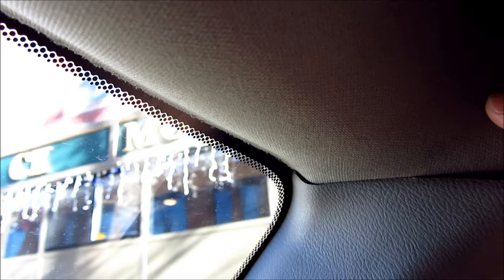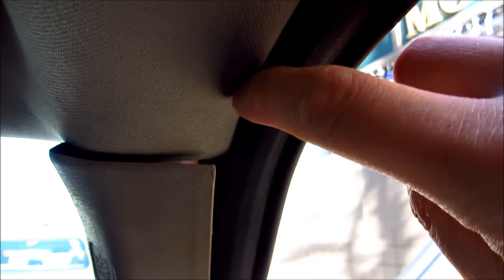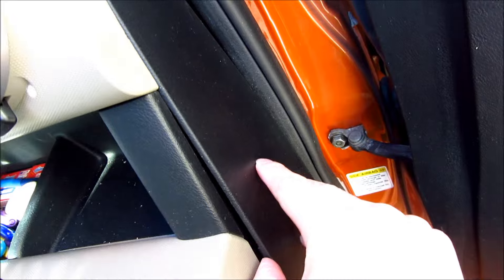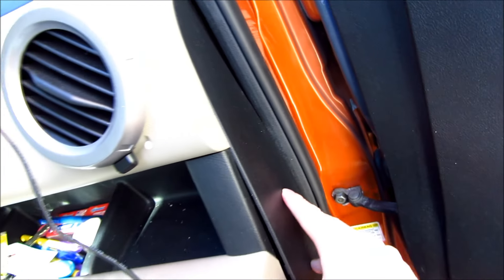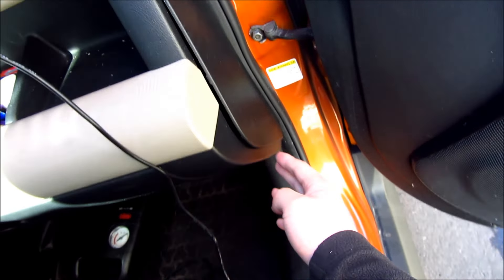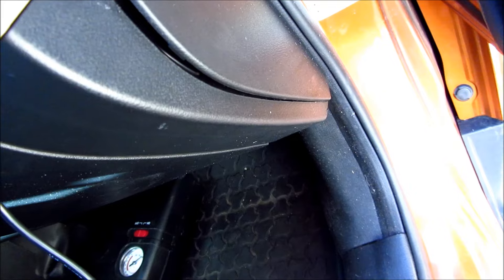For my car, I transitioned from this area at the windshield over and underneath this. These things are very flexible so you could just push it along and hide it behind here. When I come down to this panel, you could pry it open — in lots of cars you can pry this open. I'm going to pry this open and thread it over. All these steps are going to be particular to your car, or you can hide it behind here, go down to the floor, and handle it that way.